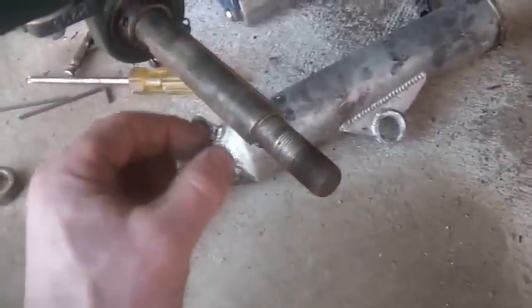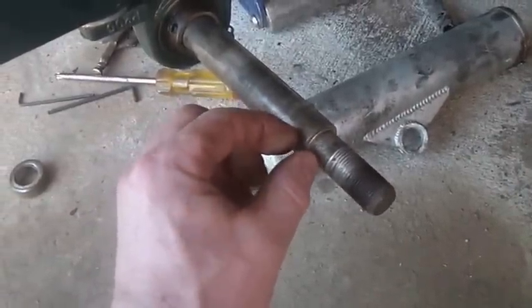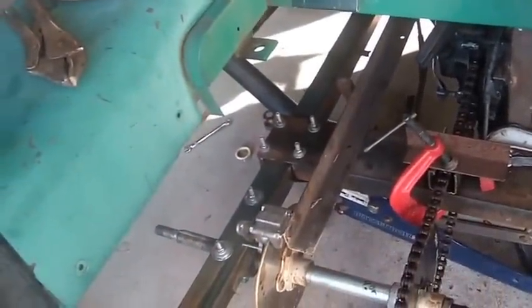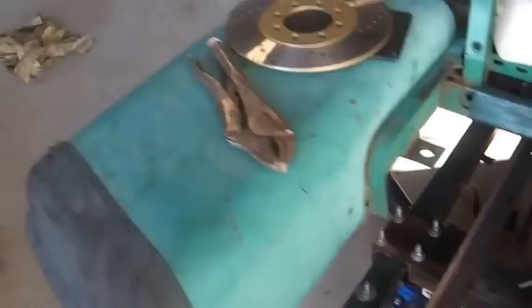And then when I bolt the wheel up, I'm going to extend the sleeve so that maybe there's a 1/4 inch out here, which will move the wheel out. Then if I throw a couple of washers on here, it'll move the wheel out a little bit more. So the wheel isn't tempted to go near this, right? So yeah, when you start mocking this stuff up, when you start looking at final assembly, you start noticing, nope, too close, that's rubbing.